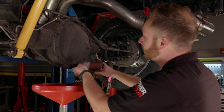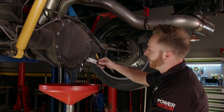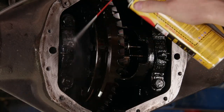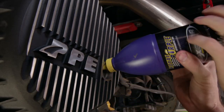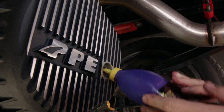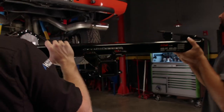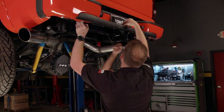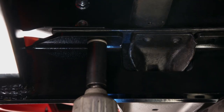We're finishing up some last-minute details on our Supermax diesel build. The rear axle that came underneath our truck is more than strong enough to support 500 horsepower, so all we're doing is changing out the fluid. I'll clean up the mating surface, rinse out the housing with brake cleaner, and install a PPE cast differential cover. The aluminum helps dissipate the heat and it holds more fluid. Our original hitch was long gone, and since this is a truck after all, we still need to be able to tow with it. We went to Summit Racing and picked up a Class 4 hitch that bolts in using the factory holes. The Class 4 rating means we can run up to 1,000 pounds of tongue weight and 10,000 pounds of trailer, which is probably more than we'd want to haul with a short wheelbase truck anyway.